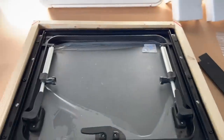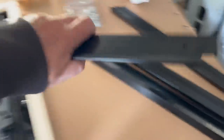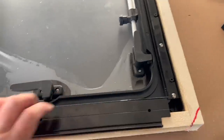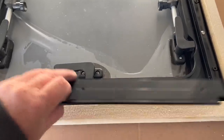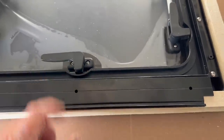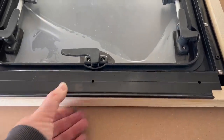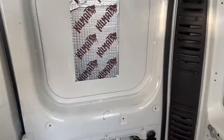Albeit it's the same manufacturer and same window type roughly, the fixings are far different. Now you've got these caps rather than the little metal pieces that went across. These screw into the recessed holes, sit over there, and then clasp to sandwich the frame from the outside to the inside. Frame in, centre point in, same as yesterday, drill through, transpose the measurements over.